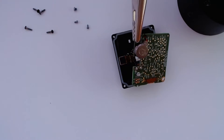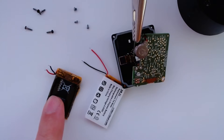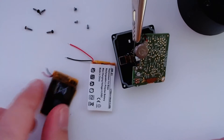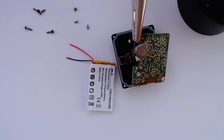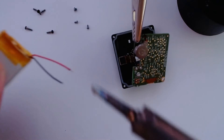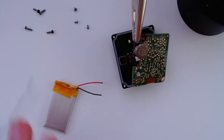So this is the old battery and this is the new battery. A slight issue here is that the old battery has a slightly larger capacity than the new one — the old one is 167 milliamp-hours and the new one is 120 milliamp-hours. So it's not going to last as long as the old one, but in my case because the old one is totally busted it's still going to be a bit better. I'll add a bit of solder to the tips of the wires on the new battery — they're already exposed — and then we'll solder it to the motherboard.